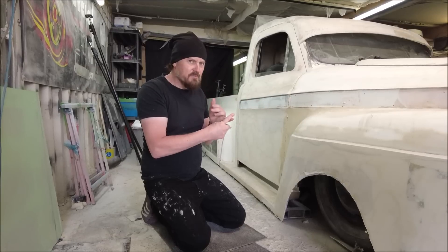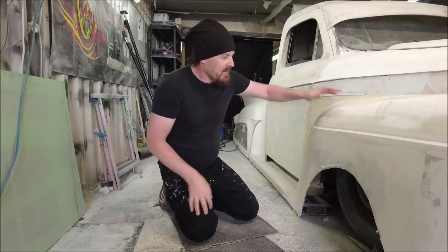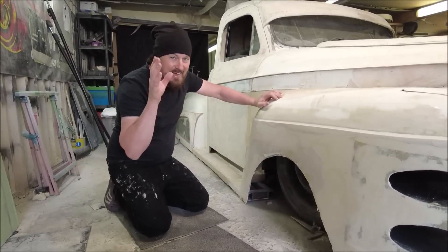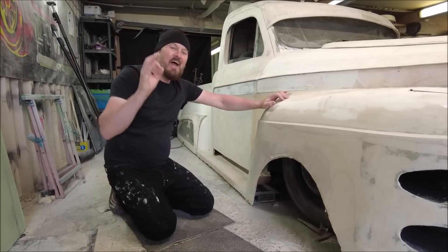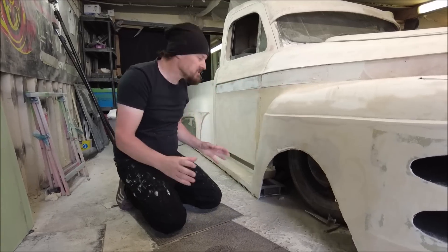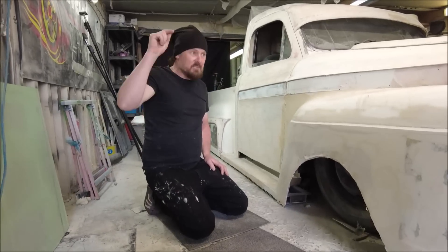So to the table saw — rip down a strip of aluminium, get that bonded on there, and then start feeling the way to it. What I'm doing here is making the frame and putting a flat piece of ally on there. I'm going to snow plow up to it and get that all right, and then I'll make the bit that fits inside of that. After that, that's when I'll make the piece that trims around, goes over the snow plow and forms an actual trim over it — so when it goes on it locates and just fits like a manufactured thing.